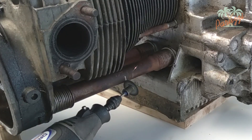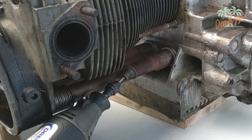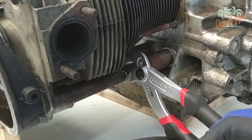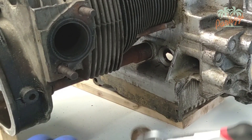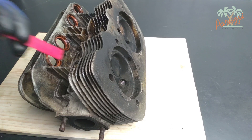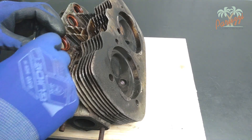The best way to remove the tubes is to cut them apart and then remove them with a gripper. The old tubes can be very tight between the cylinder head and the crankcase. By first removing the tension by grinding them in the middle, disassembly usually goes very smoothly. In most cases the rubber seals will be so hardened and discolored that they appear to be part of the cylinder head, but of course they are not. Here we show that on a disassembled cylinder head.